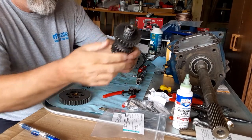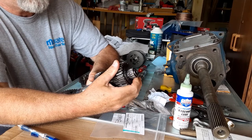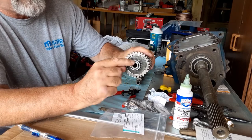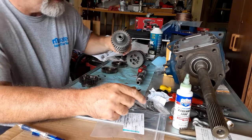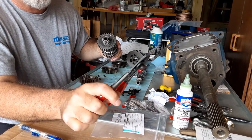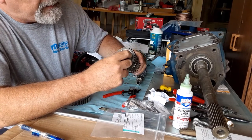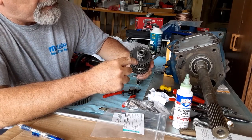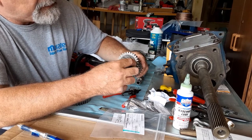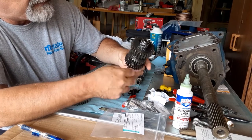The last thing left to do here was the needle bearing. The needle bearing simply slides on the end with a circlip with no ears. I used the tool with the knurled finish because it gave me a better grip. I did go with the larger diameter thrust washers — it seemed to be an engineering improvement from previous model years, so I left it like that.